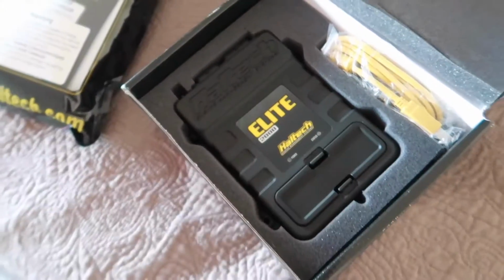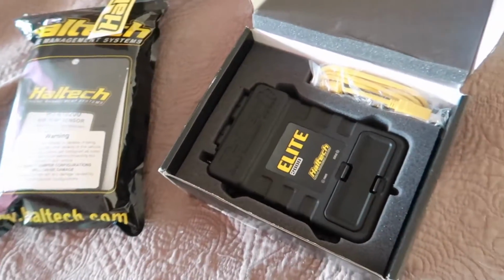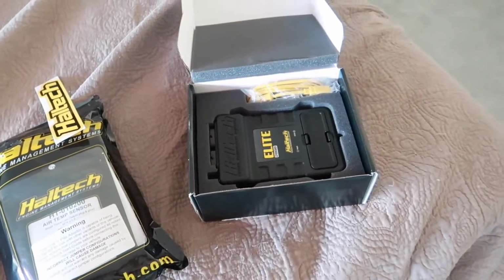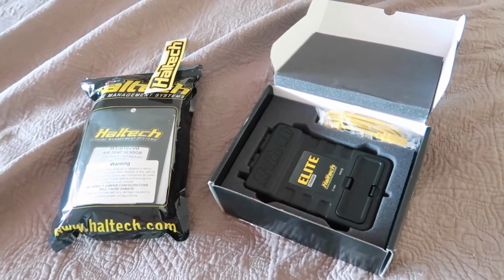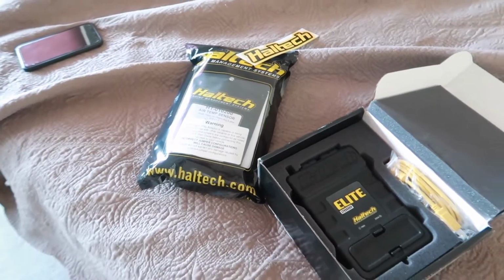There's a plethora of tunes we can do on the Skyline. Hoping to have it tuned somewhere at the end of this month, September, but still on the hunt for which turbo I want to run. Also going to go with the 6-boost top mount turbo manifold, and going to be running 750 ID injectors. So I gotta get those all installed as well, and then hit up Evan.